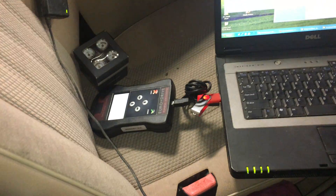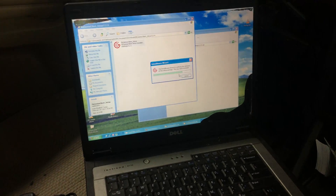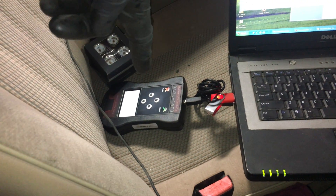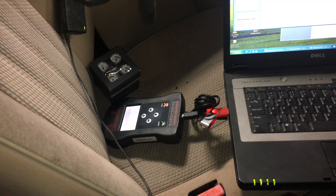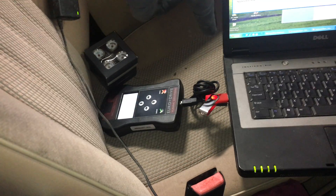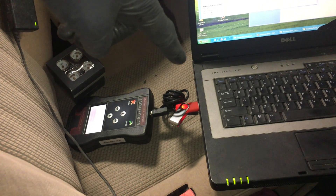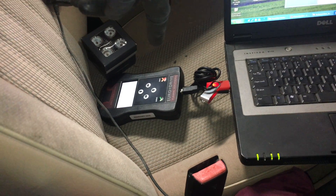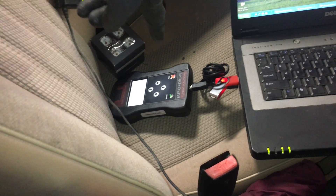I'm going through and setting it up right now. Basically, once you get it, you plug it into the computer, you get download files from your tuner, you install it, and that writes a definition file to your MyGenius — which is that little tuning box thing right there. Then you can bring that thing over to the car, rip the factory tune out of the computer, bring it back over here, upload a copy of that to them, and then they give you a performance tune back. You throw it on the MyGenius through USB, and then you can write or switch tunes on that device.